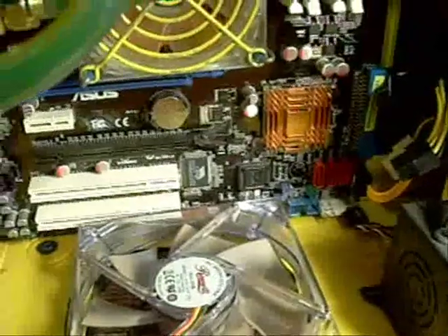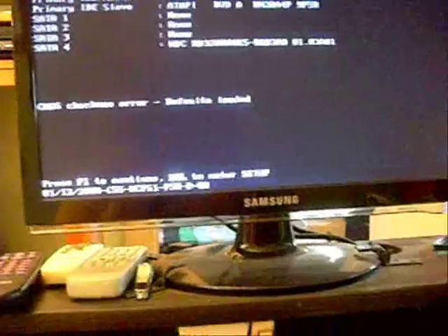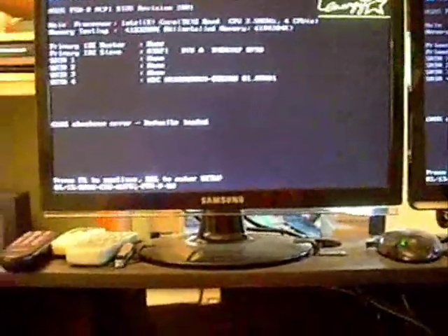I'm going to shut this off and put the video card back in. Okay, I have it all put back together — got the video card back in, covers on. Figured while I had it apart it would be a good time to blow it out and clean the case as well. So I'm going to plug it in now and show you what it will do when you start up. Alright, it will say press F1 to continue or Delete to enter setup. CMOS checksum error — defaults loaded. That just means it all went back to the defaults and now we can go into the BIOS and change our settings and put the boot order the way we want. And now when we save it, it should save it and reboot to that every time. It's a simple little tip but something that maybe a few people don't know, so I thought I would do a video on it. Thanks for watching.